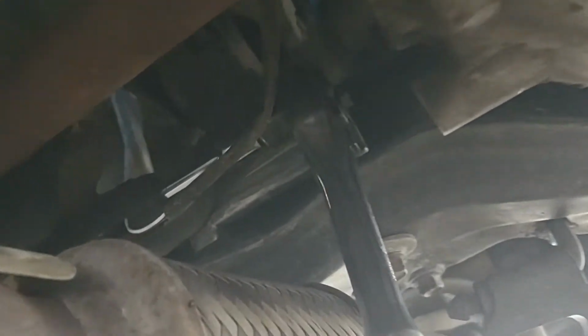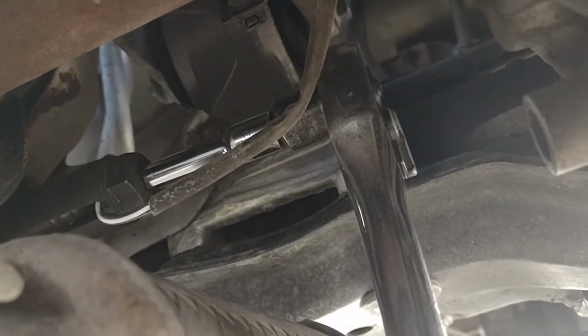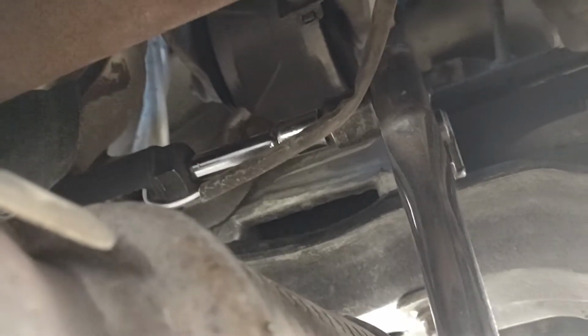Okay, you'll have to put together a combination that works to give you access and to be able to swing this. I had a little longer half-inch extension, but it brought the ratchet back in contact with the transmission housing and crossmember here, so I ended up with a 3-inch, 3/8 inch extension. My socket is a 3/8 inch drive, and I'm using a half-inch ratchet with an adapter to 3/8, just because it'll give me more torque and that little extra extension, which gives me more clearance back here. So just use whatever you've got that works and twist hard, and hopefully it'll come loose.